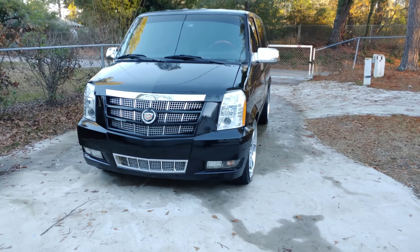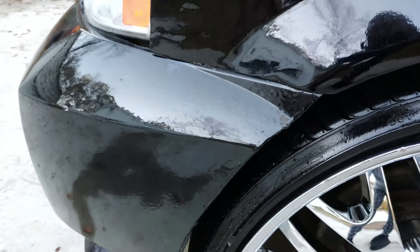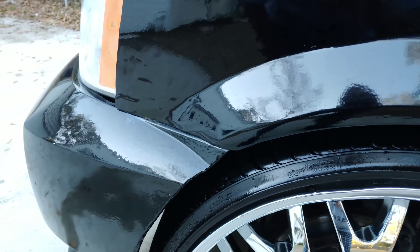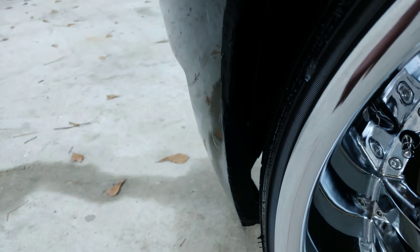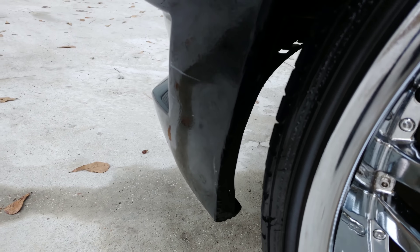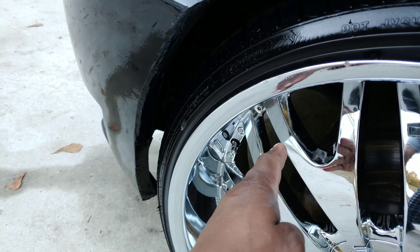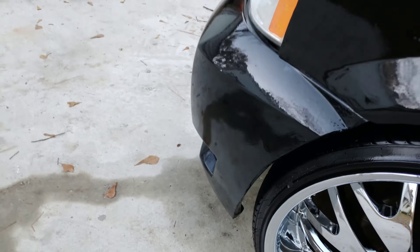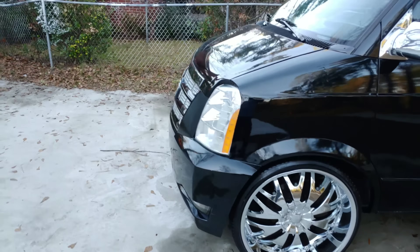This came out great — it matches the curve almost to the actual bend of the fender. But right in here I had to cut this down and reinstall the little lip to make it look more factory, because it was too far back. On the Escalades they come back about that far, so you have to cut it all the way up and then shape it to the shape you want your wheel to be able to turn, depending on the size of wheel you're using.